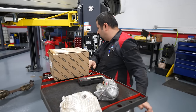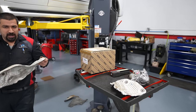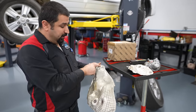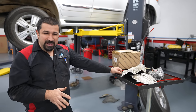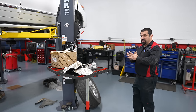The other shield on the exhaust manifold is not bad to install once the pipe is out. But the worst part is this flimsy shield — once you pull it out, if you mangle it, the holes won't line up and now you're there fighting to bend it back. This is such a horrendous design; they could have really done better. And you'll notice the labor times on this job vary significantly.